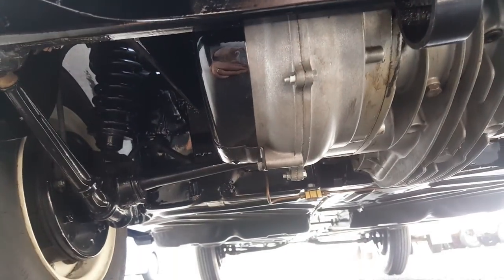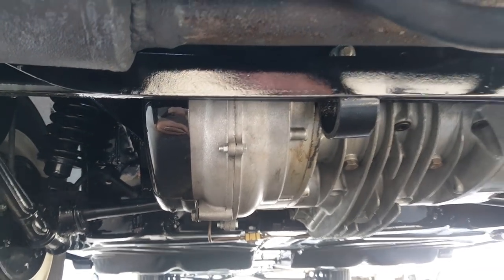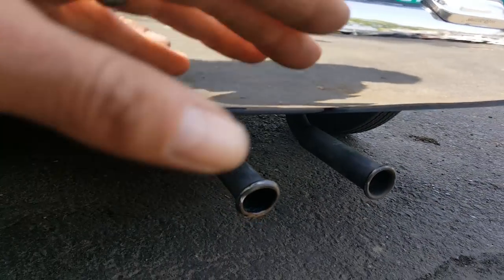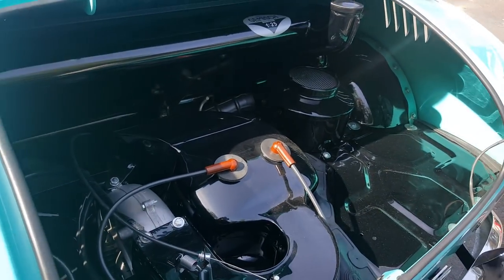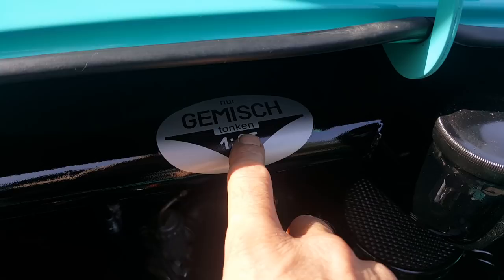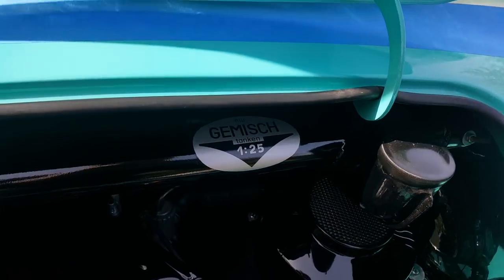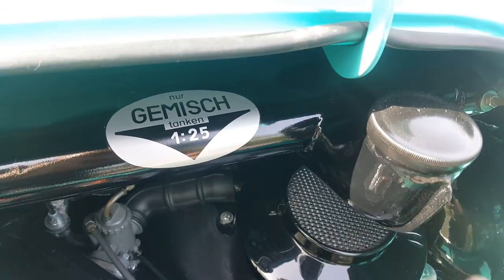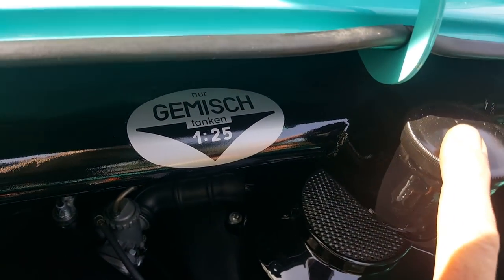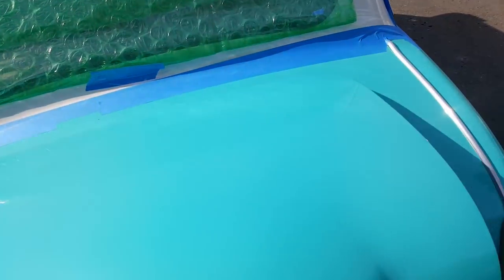The whole car is painted gloss black — the complete undercarriage, all the suspension — and it's not done in a bad way, it's beautiful. We have two exhaust pipes, one for each two-stroke cylinder. It's a 250cc. Oil tank up here — this is where our oil is mixed into the fuel. Actually, this is not injected, it's mixed at that ratio. So this is the fuel tank; the fuel is added here as well as the oil, mixed at that ratio.